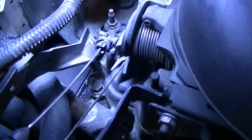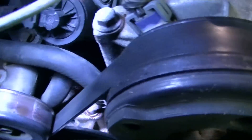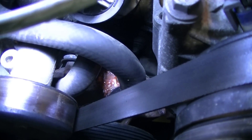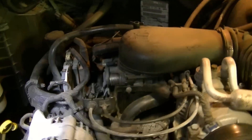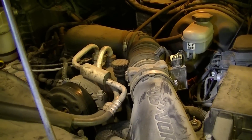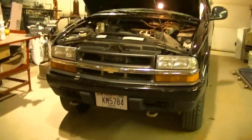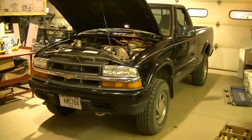I really can't see. There is some liquid down there, but I think it's the driver's side that's leaking. And the water pump, which is a fairly new water pump, it's got leakage on it. So I'm going to have to change that too. There's a ton of stuff on the top of this motor here, so it's going to be an interesting job. It'll probably take me two or three days to do this. So once I get Dad's Camaro away from the hoist, I'll get this on there and maybe when I raise it up I'll be able to see exactly where it's coming from.